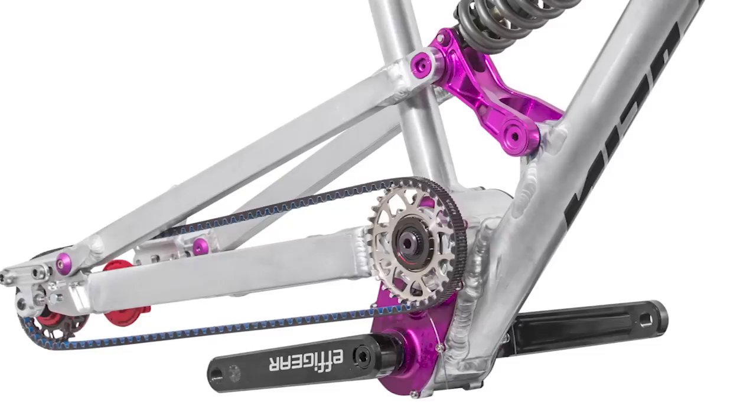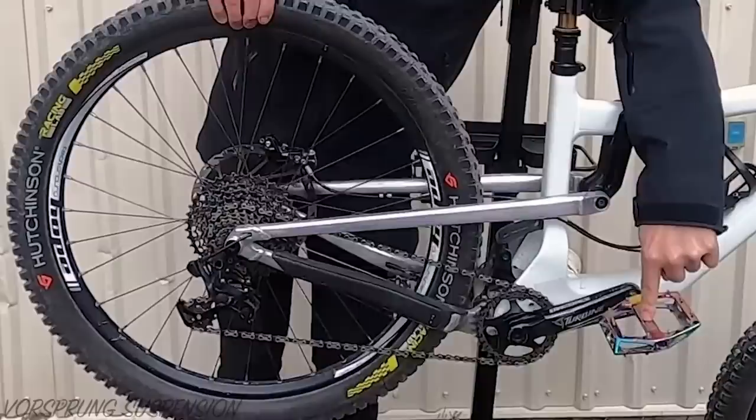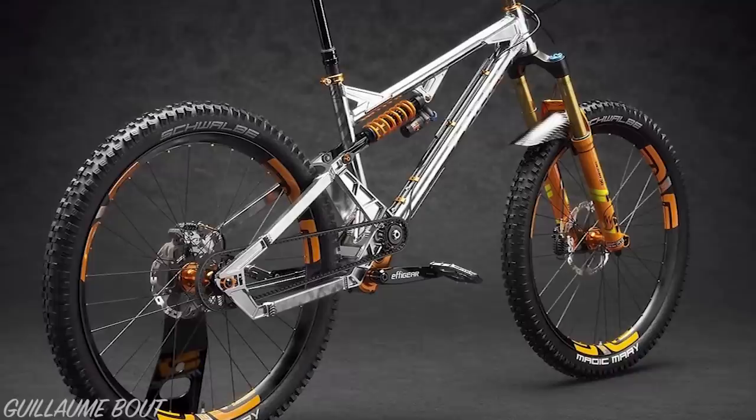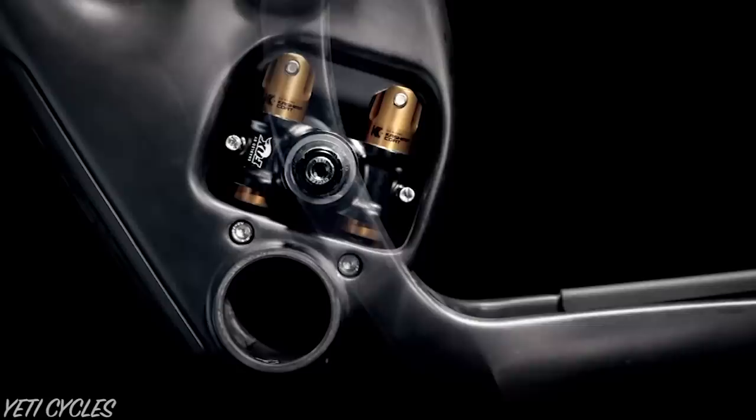And this was for good reason! Unlike the Pinion gearbox, Effigear had its drive sprocket located separately from the crank assembly. This allowed full suspension frame designers to build their swingarm pivots around the upper axle of the gearbox, creating a simple and silent drivetrain, but also reducing the effect of chain forces on the rear suspension. The downside to building frames around a large volume gearbox is that it significantly restricts what frame designers can do with their linkages, which largely determines the ride characteristics of a full suspension bike.